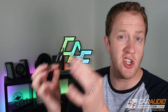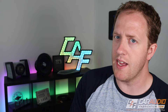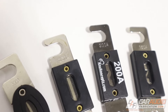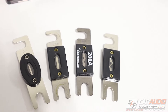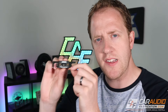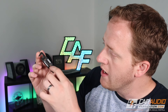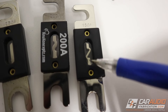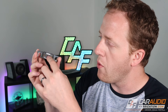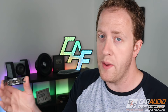Fuses come in many different shapes and sizes. Can we take just any fuse and put it on a wire so that wire is protected from a short circuit? Not necessarily, because the fuse rating might be too high for the size of the wire we're using. So how does a fuse work? Inside there'll be a smaller strip of metal where all the metal necks down, giving us a failure point. If there is too much current going through the fuse exceeding the fuse rating, it will burn through that small amount of metal, thus breaking and opening the circuit.